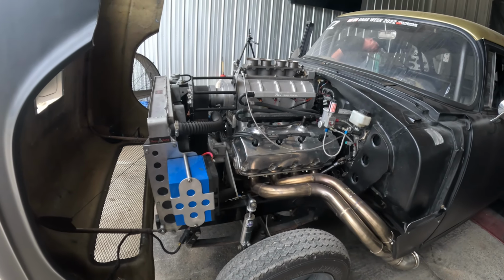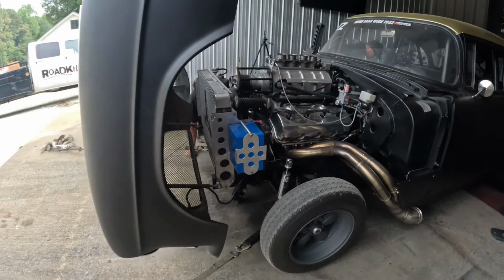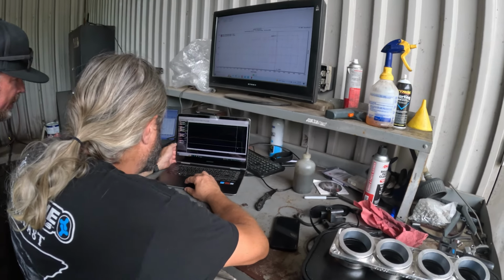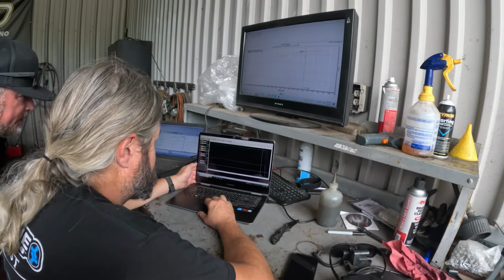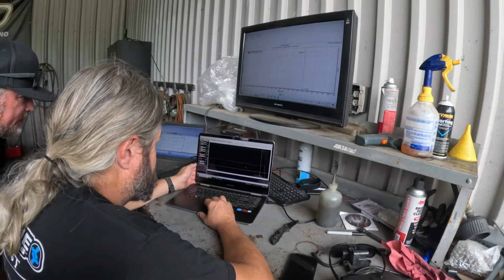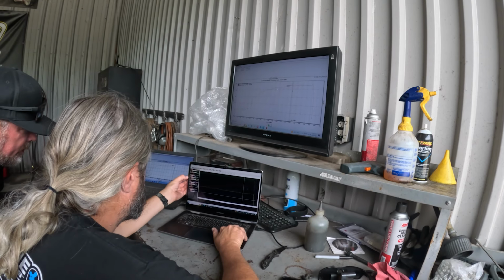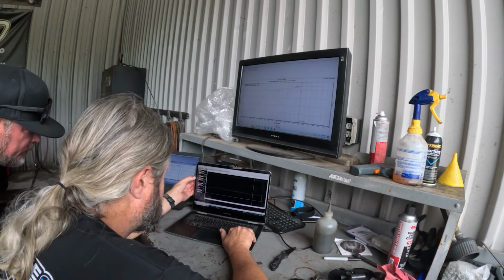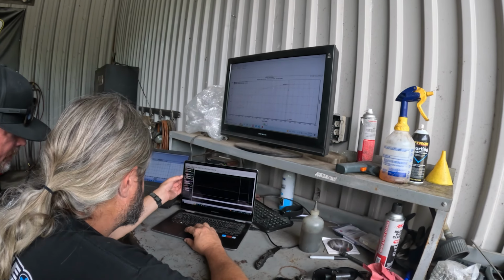It was warmer than it has been. That was 187 degrees, which I thought was weird. It got warm quickly. For whatever reason, it's pulling a ton of fuel out, and it's still rich. Our target's 6.5 right here, and we're 6.4, 6.2, 6.1. We're under the target, and it's pulling 20+%.